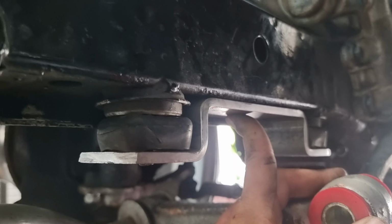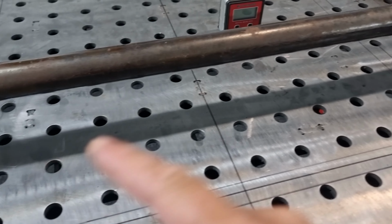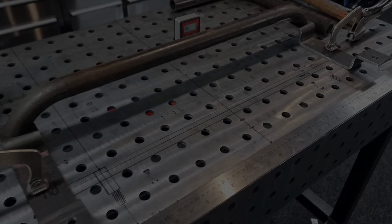This is the stage we're up to now, so in the next video you'll see we end up making another hoop that comes across here. The reason I want two of them is because I want a lot of support for the spindle. So how we're going to be making that spindle is basically we'll get a bit of stock, machine it down, cut the thread in the end, then we'll drill out the second one that's going to be here, put it through, and weld to this side, back side of it, front side, so there'll be 4 welds in total. And we'll obviously add gussets, and then we'll add some strengthening through the middle there as well, some bracing. So we'll touch base on that in the next video.